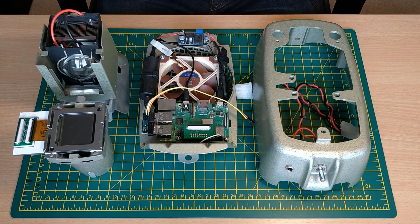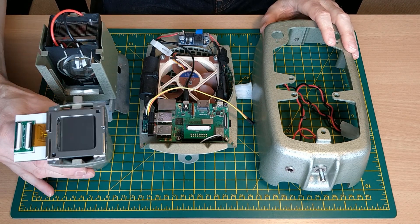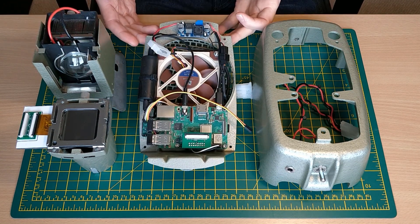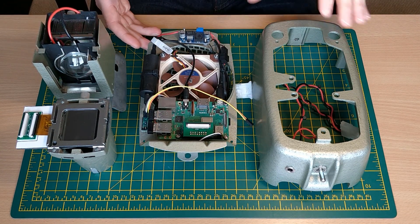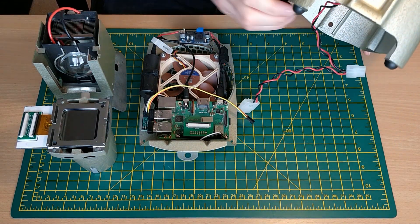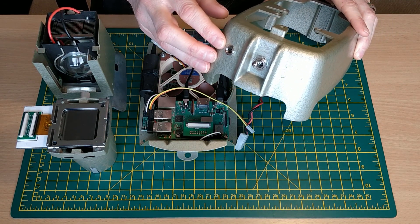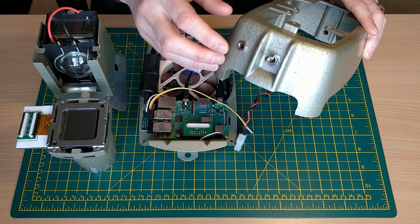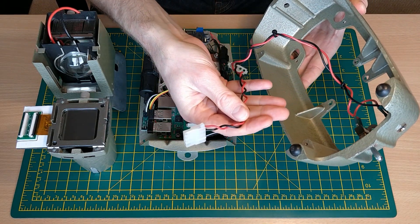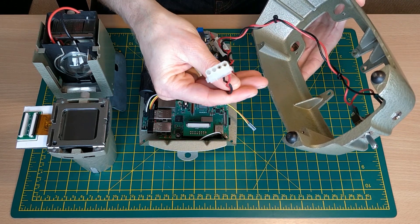First, let's have a quick overview of how this is all put together. The main components are the LCD, the LED assembly, and the main board, which contains most of the electronics. This stage here distributes the power between those sections. You have a DC input jack at the back, powered by a laptop charger which outputs 19 volts at about 3.4 amps. It goes through the main switch, and then the power goes into two Molex connectors that distribute it either up to the LED module or down to the main board.